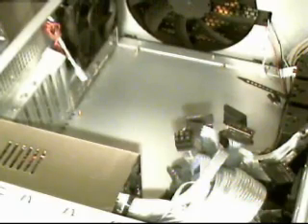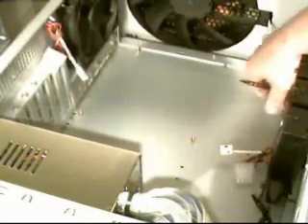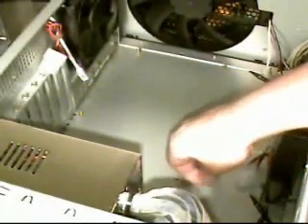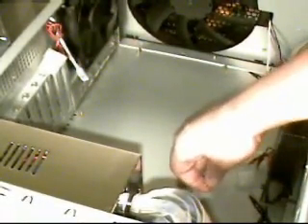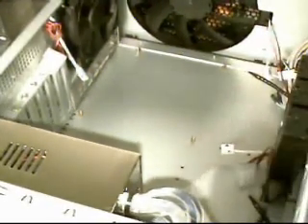Then you can install your heat sink. Now it's time to install the motherboard. Before you install the motherboard you must remove all the cabling that's in the way so the motherboard isn't obstructed. You also must install these little brass motherboard risers — they're small, they're there to help you screw the motherboard in, because you're not supposed to lay the motherboard flat on the case panel. Once I get the risers into place and the cabling out of the way, I'll show you how to put the motherboard in.